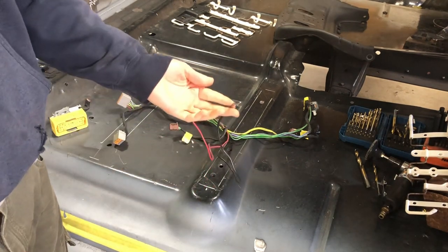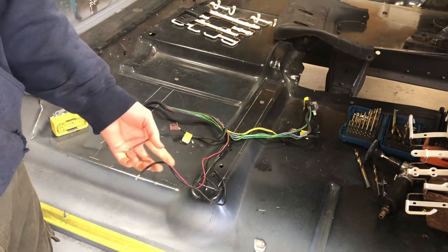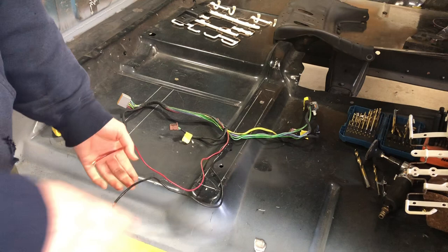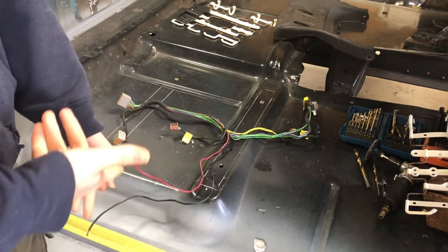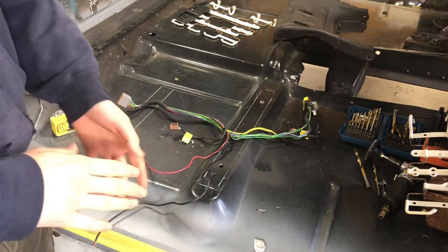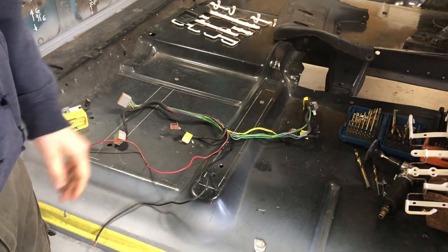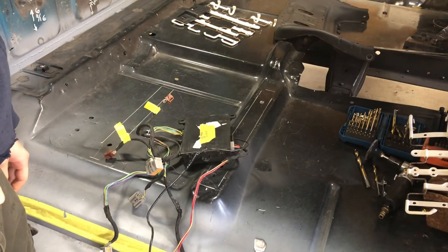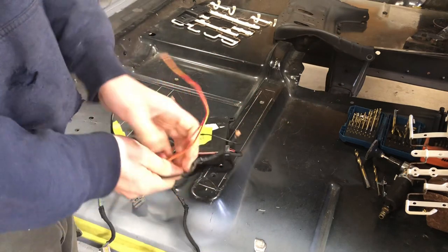There is also a passenger detection unit — it's got a bladder in it, and when someone sits down the bladder pushes fluid into a sensor that sends an electrical signal to the computer, telling it there's someone in that seat, which triggers the safety functions and airbag stuff. I removed that, and both seat-side airbags as well. When you're done, you go from all those wires down to just two — this will power your adjustments and you're good to go.